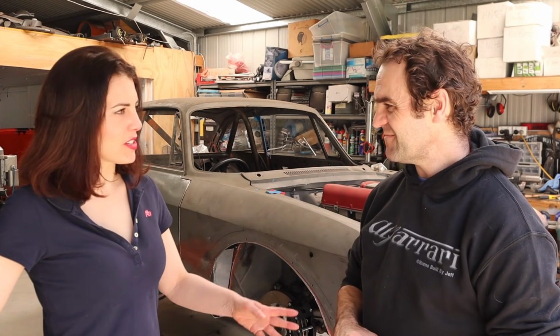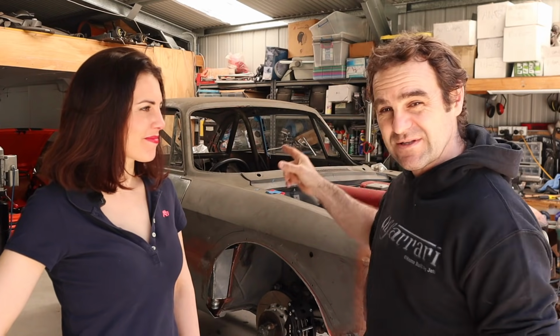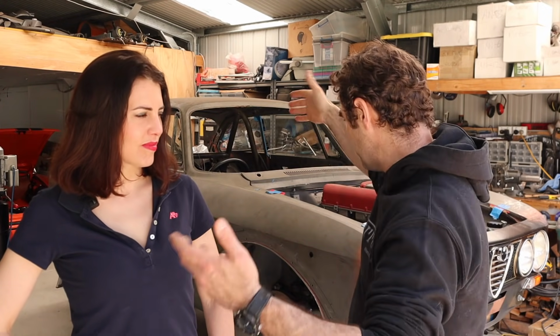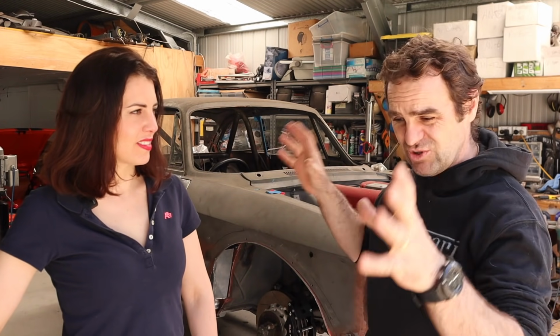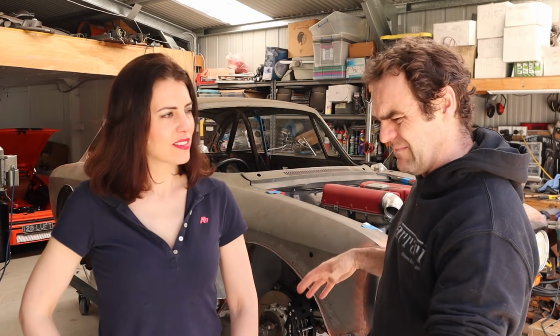Yes. Just enjoy what you've done so far. Yes, exactly. And I know I've got some interesting 3D printed grommets I'm going to have to build to block off the hole I put into the rear boot section, because that needs to be sealed, at least for Australia. We have to make sure that the fuel cell is completely separated from the rest of the car. So that's all part of it, even though standard the fuel tank is sitting in the bottom of the boot and there's holes through the parcel shelf. That's not acceptable as far as the engineer is concerned. So anyway, we'll patch them up and move forward. We have very stringent rules and regulations here. Yes, very stringent. Do what you have to do for the country.